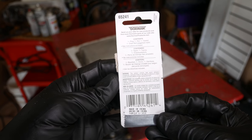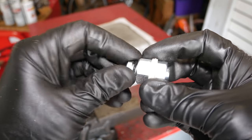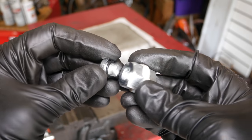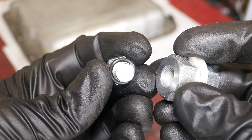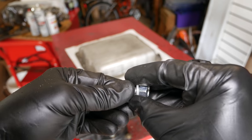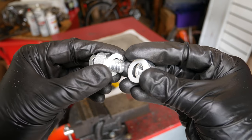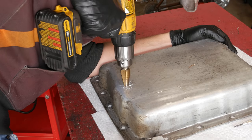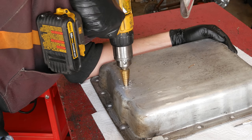This is a Dorman parts kit specifically designed to install a drain plug to a transmission that didn't come with one from the factory. It's kind of tall, and the actual drain plug is pretty small, but we'll just have to see how it works out. The drain plug itself only seals via an outside o-ring, and the plug insert housing seals to the transmission pan via two plastic washers. Just like the other methods we've used, installation of this kit starts with drilling a hole. The outer diameter of the housing is half an inch, so that's the size hole we need.